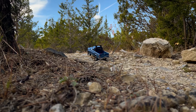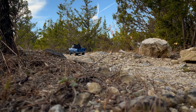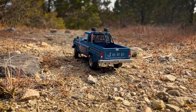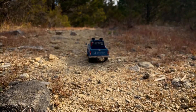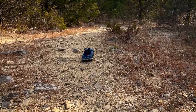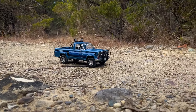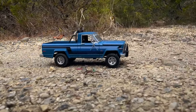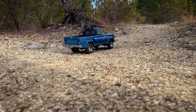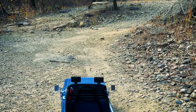This J10 is much more of a trail truck than an all-out crawler, so we chose the terrain accordingly. What a difference four-wheel drive makes. I've not yet had any issues with the front axles since soldering the springs into place. For my next build utilizing this chassis, I think I might step up to a slightly thicker spring, since the steering servo seems to be able to steer the truck just fine, and I'd like to take some of the slop out between the rotation of the inner axle and the outer one. I have to be careful not to get any grass or small twigs caught up in the springs or wrapped around the axle — this is especially important with a truck this small. Overall, a mild trail run for this second test drive, but I was really happy with how the truck was performing.